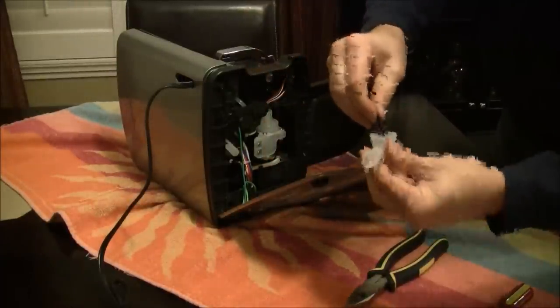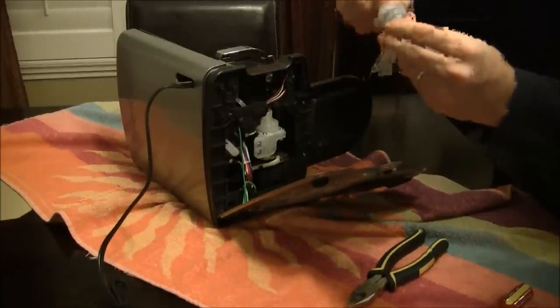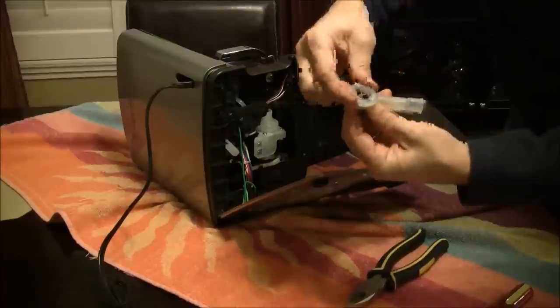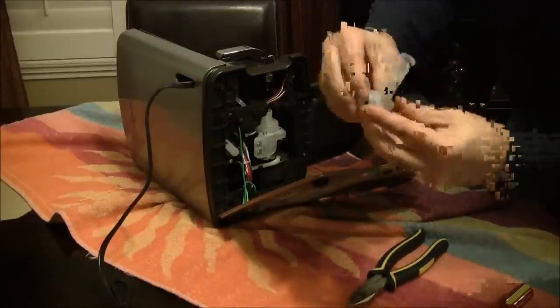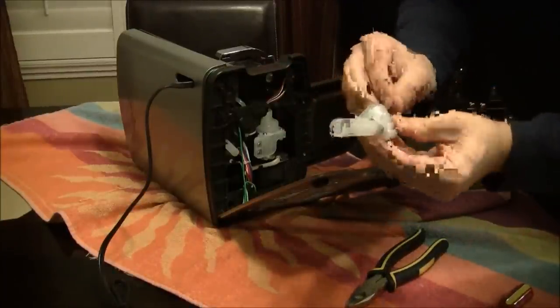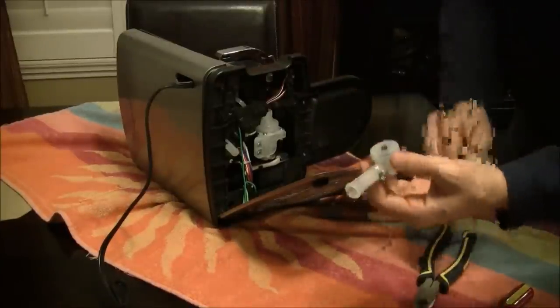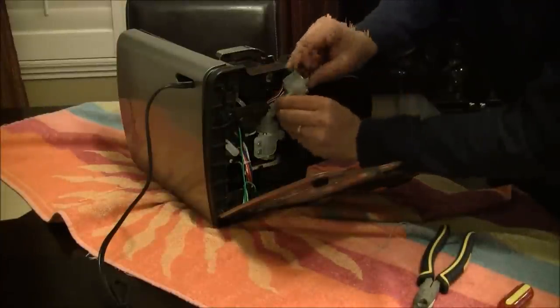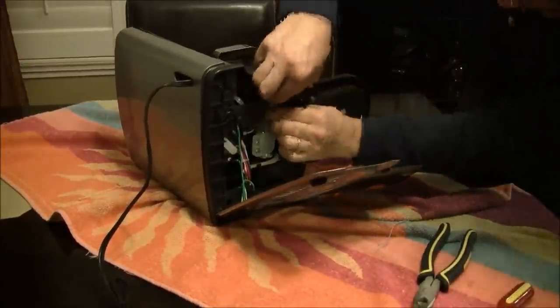Now I'm ready to put it back in the machine. If you don't want to watch the whole reassembly, you can skip forward in the video to six minutes and sixteen seconds, and you'll see the back is off the machine and you can actually see how the machine runs a little bit. I did have my machine further apart than it really needs to be, so don't be alarmed by that. The only thing you need to do to clean out this filter is to take off the bottom cover. I had the top cover off as well as the back while I was diagnosing the problem. Now I've got the filter firmly back in the rubber there, and we're just going to put it back together. Just make sure you get the silicone rubber all the way onto the pump there before you get that clip back on. And then get your screws back in place.